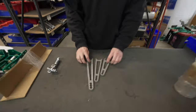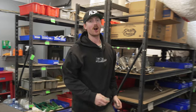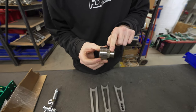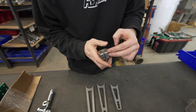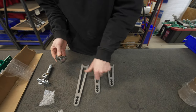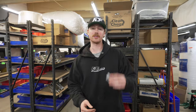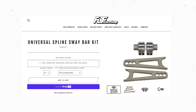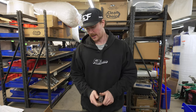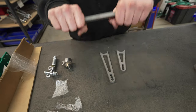These are the standard blades that we sell with our sway bar blade kit. It comes with a male end, a female end, and two pinch bolts that will clamp this. You can weld these onto the bar, and these give you different lengths which offers different stiffness. We recommend this kit to be used with an inch-and-a-quarter 4130 chromoly tube. Chromoly has great spring characteristics so it works awesome as a sway bar. This material is spring material — it's extremely hard steel that really springs back.